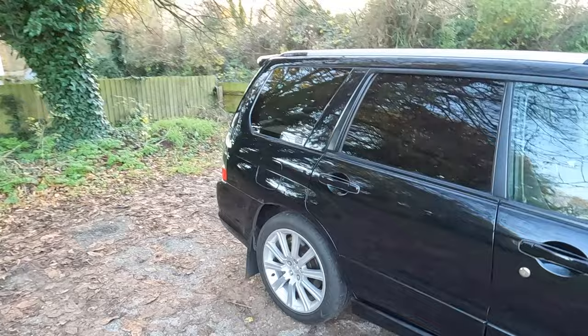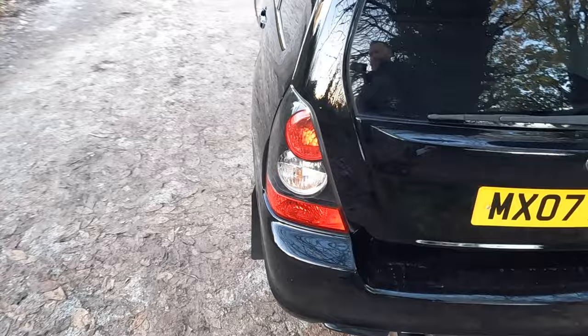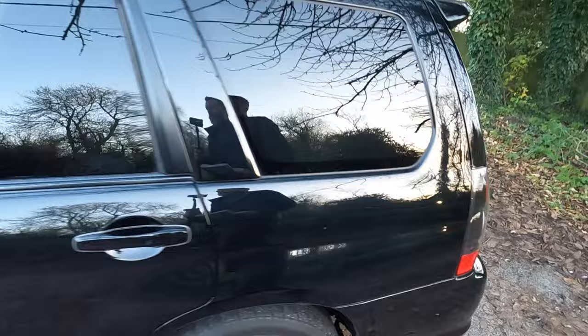So, what's in the pipeline? Could get this done quick before I run out of GoPro battery. I have got spares, but I'd rather not swap. Rear arches need doing, and that is going to be a whole new panel, that side, and whole new panel, this side. The whole thing, lovely jubbly. Can't wait. Underside refresh. That's on the list and possibly next year. You know, nuts and bolts and fasteners off, re-zinced, stripped back to bare metal, all rust gone, any welding done, new undercoat of choice, not sure yet what to use, but we'll take advice from an expert on that.